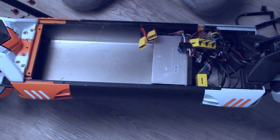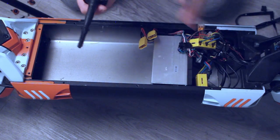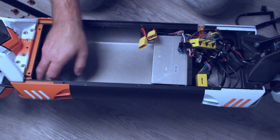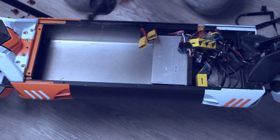For sealant I'm using EB25. You can use whatever mastic or sealant you need as long as it's graded for external use. I particularly like this one — it's not the cheapest, it's black which is the right colour for me, and it's got good adhesive strength, especially where I'm drawing these panels back together, much like drawing in a panel on a car. You could also use Tiger Seal, which is another well-known brand. I shall now put this in my gun — I've already snipped the ends off.